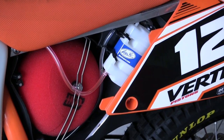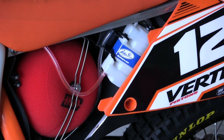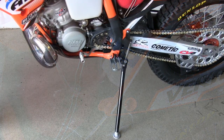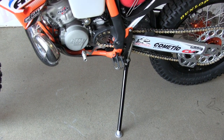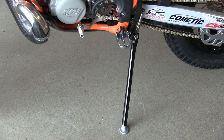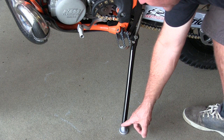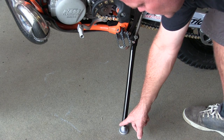We've got our Uni filter here, and right here we have our Motion Pro overflow bottle. On an off-road bike you can overheat real easily in the tight stuff, so we wanted to have an overflow. They have a nice bottle that you can route to wherever you can make do — we found some room in the air box. The Motion Pro overflow bottle is a fairly easy install as long as you follow the instructions, with two different ways of setting it up depending on your application. Here's a good look at our Trail Tech kickstand — really nice piece. We were able to shorten it up since the bike has shorter suspension, so we want the bike to sit nice. We removed the lower footplate, marked it, and cut about a half inch off the shaft, then reinstalled it.